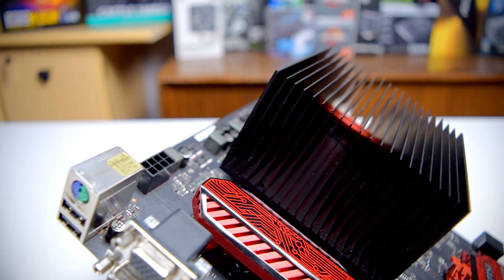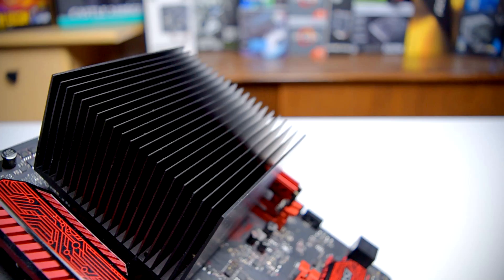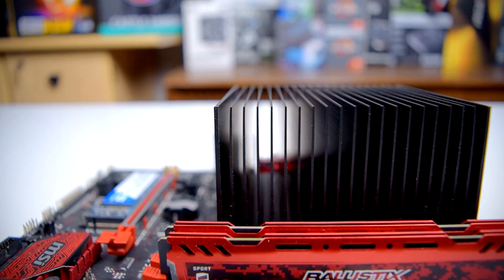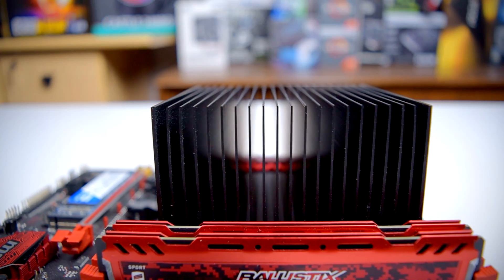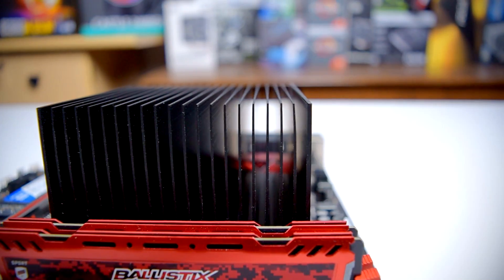It's almost a perfect cube at 99mm wide and long, and only 70mm tall. Because it is passive, heat dissipation is limited to a 47W TDP. That'll cover the Ryzen 3 2200G, Ryzen 5 2400G, and the new Athlon 200GE. Technically, most processors won't exceed or even reach their rated TDP at stock speeds, so it can handle other low-power processors like the Ryzen 3 1200 I'll be testing it with today.